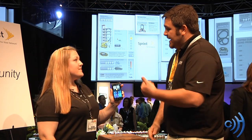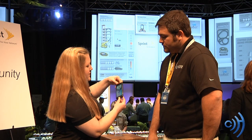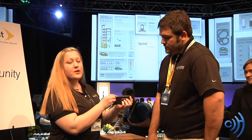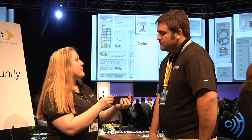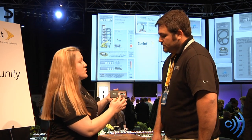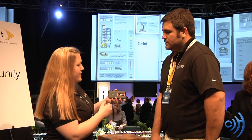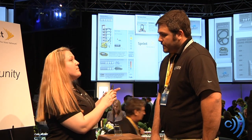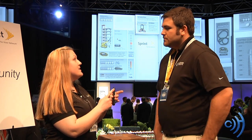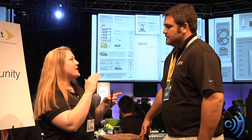Let's take a hardware look really quick. It looks a lot like the Evo 4G, but as you turn to the side you notice you've got a toggle here as well as your camera button. That toggle allows you to switch between 2D and 3D so you can take pictures in both formats. As you look at the back you notice the dual cameras — both 5 megapixel — so you can take 2D pictures and videos with one, and 3D with both. There's a micro USB port that also doubles as an HDMI out, so you can connect the content from your device to a 3D capable TV.